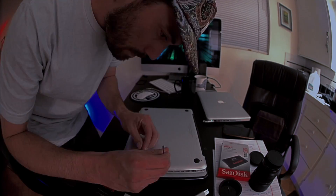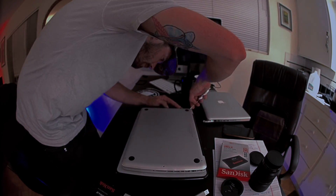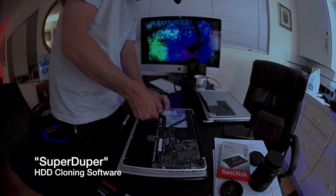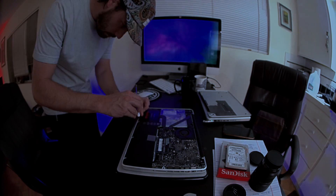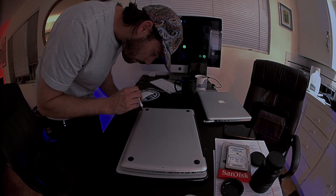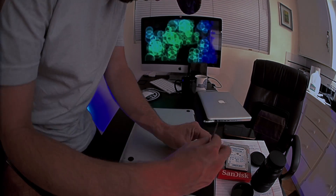Let's go ahead and replace this drive. Before you put your new drive into your MacBook Pro, you want to clone your existing drive to the new SSD. I found it relatively straightforward and was able to use the freeware SuperDuper — link in the description below. It roughly took 2 hours and 45 minutes to copy my old drive over. I also had to use Disk Utility to initialize and format the SSD prior to cloning with SuperDuper, using a single partition with a Mac OS Journaled format. Taking off the rear panel requires a small Phillips head screwdriver and there are an additional 4 screws for the hard drive backing. I put everything in a small cup so I wouldn't lose it.